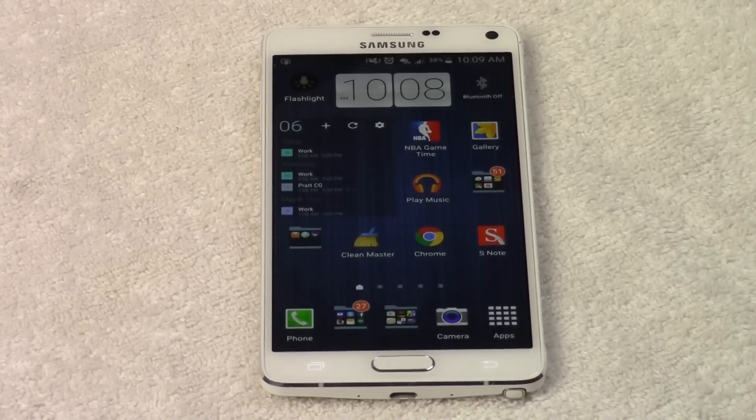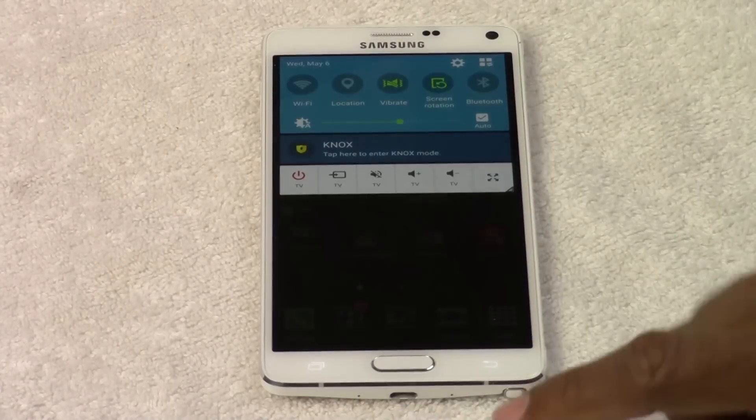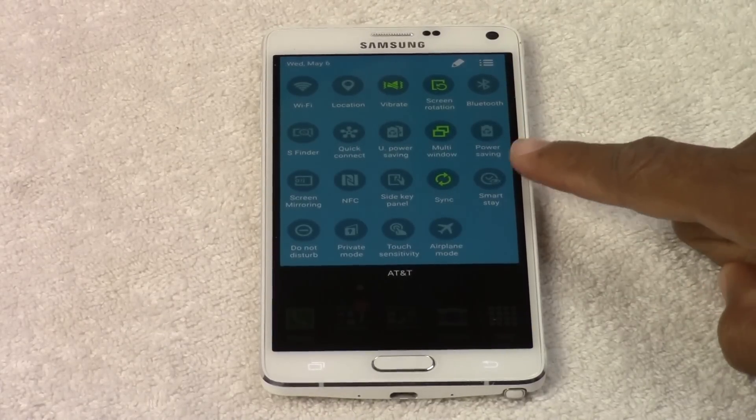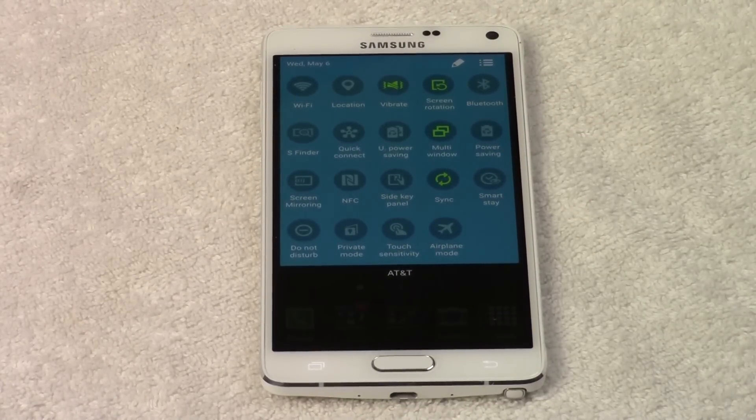If you keep a lot of apps open that tends to slow the phone down. One last thing I'll throw out — swipe down from the top and hit the button with the squares. You've got this Power Save option here which is kind of a blessing and a curse at the same time. What Power Save is supposed to do is — if your battery is running down and you want the phone to last a little bit longer — you can turn on Power Save and it will allow the phone to save some battery, but the way it does that is it turns off certain apps and slightly slows the phone down so certain things will take longer.